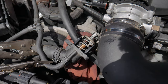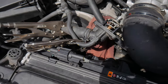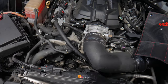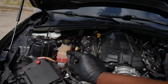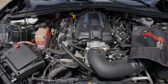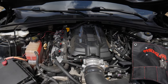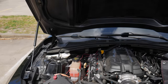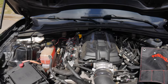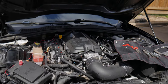You're just gonna take the new thermostat and plug it right in, then repeat the process backwards. Now that we got the new thermostat installed, all you're gonna do is put the thermostat housing back in place and tighten down these bolts. Once you get those bolts tightened up, you will lose just a tad bit of coolant that was already in the housing. All you're gonna do is go ahead and crank up the car, let it run, let it get to operating temp, and you should be good to go. I don't believe I have to bleed the system solely because I didn't lose a lot of coolant and the coolant is still at the max line.